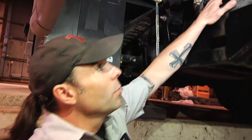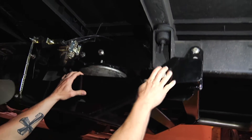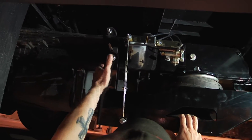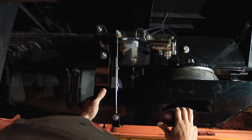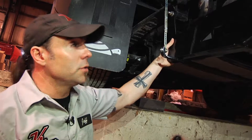The installation on this system is very easy. Four bolts on each side hooks up the upper framework. We have a bolt here to our pivot point, and we have a bolt here that hooks up to the factory shackle. The entire installation for a system like this with controls is four to five hours at the most.